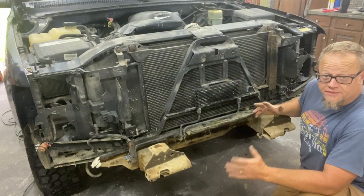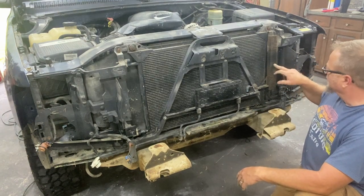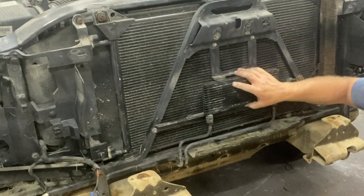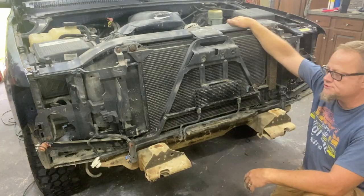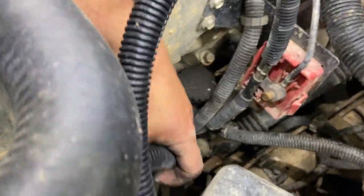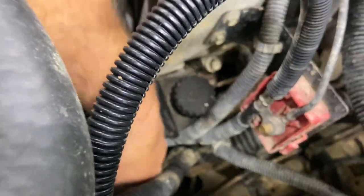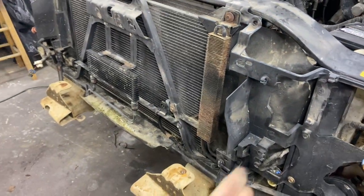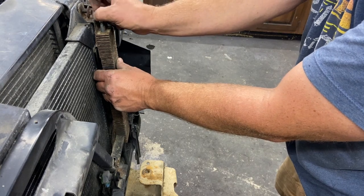So we're about to the point here where I think I'm going to have to make a mess. I'm going to work on disconnecting the power steering cooler, and we'll disconnect and snip the rubber lines for the transmission cooler — I think that's what that is right there. And then of course the radiator, we'll get that drained out by disconnecting the bottom hose. Actually I changed my mind — I'm not going to snip those lines. The power steering pump is right down here and the gearbox and all that, so I can reach right in there with a pair of pliers and actually just disconnect the two hoses. That way this whole thing will be intact and maybe I'll use it or sell it. Instead of destroying those lines we'll just take the clamps off — a couple of 10s right here — and should be able to fish that out with those lines intact.